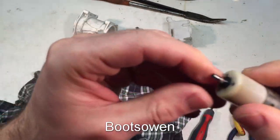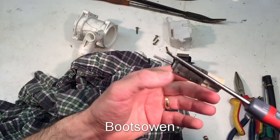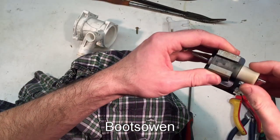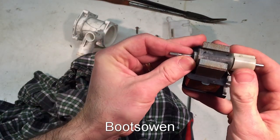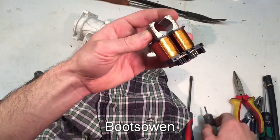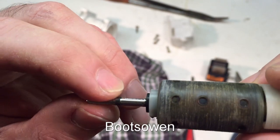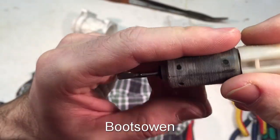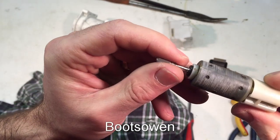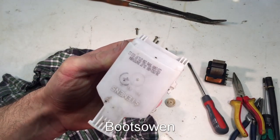The back shaft looks okay. It's worn but it's not dead. You'll have magnets in there with differing poles, so when they are inside this magnetic field they're held in the bearing in between perfectly, and then the magnetic field changes and they just go zip zip zip and spin around. So that's what's going on there. That's the mode of failure — that worn shaft — and sometimes either the magnet can get stuck to one side just that little bit, or it's just that bit out of balance, and that means it just doesn't work. So what was that? A Siemens pump — too many numbers. A Siemens pump.